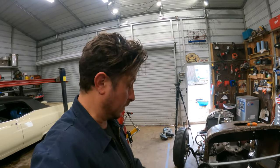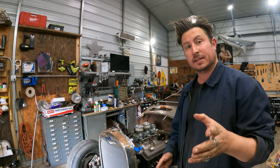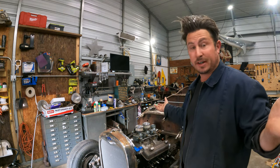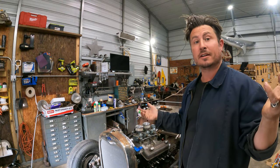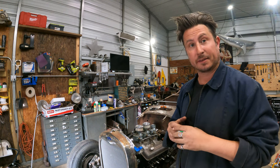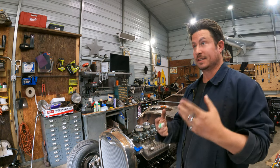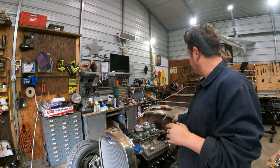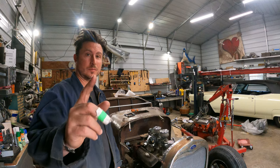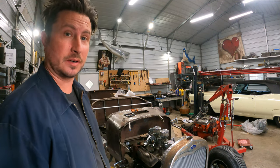I'm excited to see this thing with fenders and white walls. So there you have it — the firewall is kind of in, which is something it could not be had we not cut it and flipped it around. Now if you're doing this on your project Model T, hopefully you're starting with a cowl that's not quite so smashed. But they're 100 years old — they're getting harder and harder to find. You've got to work with what you got, and save every one of them you can. Even if it's not perfect, this thing is going to go down the road and be one more that's not a parts car — it's going to be a car car. This does buy you two or three inches, which is a big deal on these little bitty cars. We'll see you next time on Between the Sharks. If you made it this far, high five that subscribe button — it's about to get super, super cool.